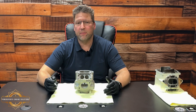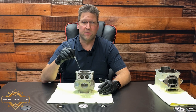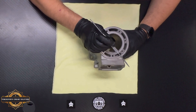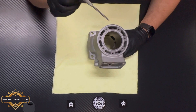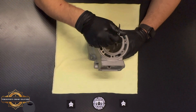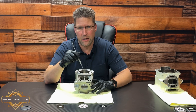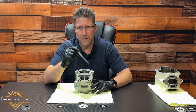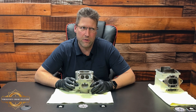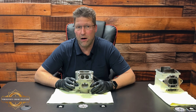Video number 38 — we're going to talk about when we do fix cylinders with CNC machining, how does that work, and do I need a different size piston? When we CNC a Nikasil by cutting it with a very expensive machine and diamond, we're only taking off a very small amount: a quarter thou, a half thou — you can go up to three quarters or even a thou, no problem.